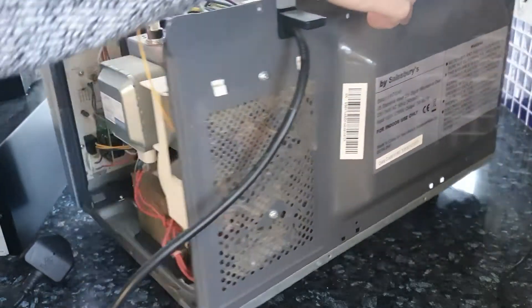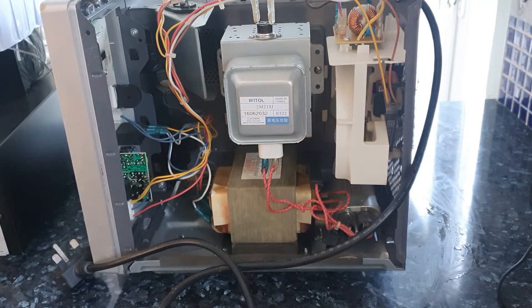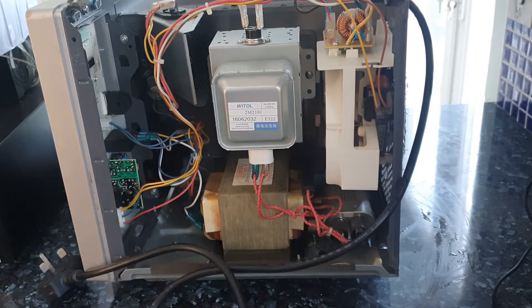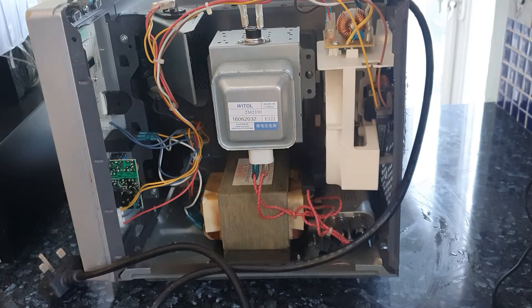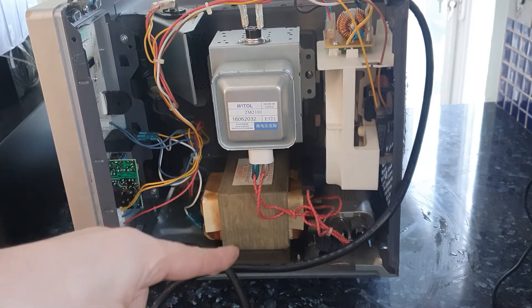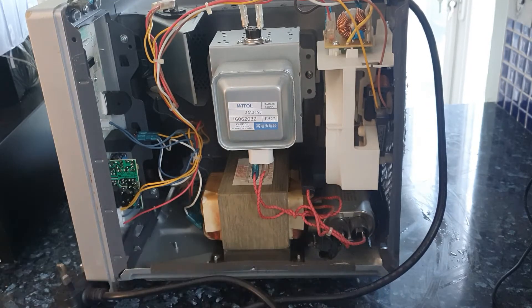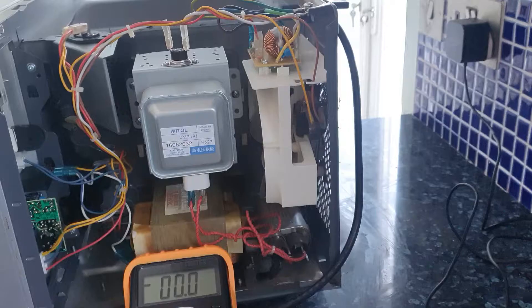Now that we have it open, look into the side of the case. Down here is a large capacitor, which can hold charge, so you do not want to touch that until you've either discharged it or left it unplugged for a day or two to make sure the charge has drained out. You can look up a video online on how to discharge a capacitor — you can do it with a multimeter set to voltage mode and test across the positive and negative terminals. I'll show you quickly: there's no voltage in this capacitor here, as you can see my multimeter is set to volts.